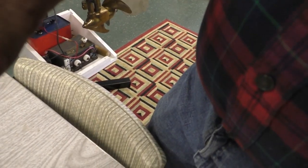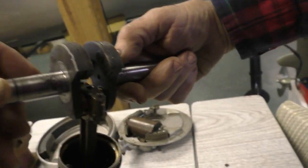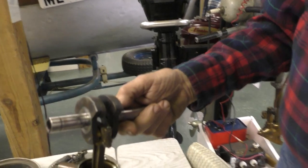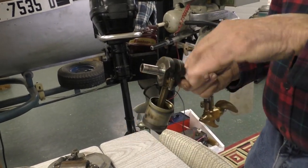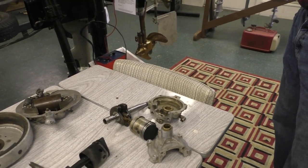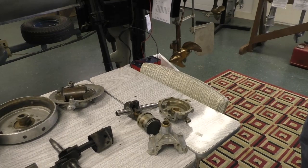Right there, that hole in the crankshaft lines up with another hole, which is probably hard to see. You can just barely make it out. It's a passage that's drilled all the way straight through. And that delivers oil to the center of the crankshaft, which just spews out and slings it onto the rod. That's another big breakthrough that probably disappeared at some point. It was probably determined that it was too expensive. Those get expensive to do, oiling, all that work. Lubrication gets very expensive.